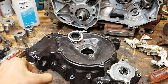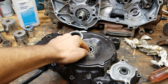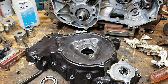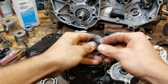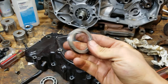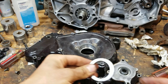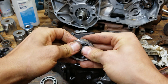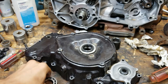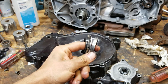So this part's a bit weird right here. I had to pound this bearing out. There's a bearing that sits down in there, and then it's got this spacer, and then it's got the seal. The spacer has an O-ring around it — it's got this O-ring all the way around it and it's got corrosion all over it, so I've got to clean that up. Basically this pushes in here, and I know this is model specific, but this pushes in here, then that pushes in there once the bearing is below it — it stacks like that.